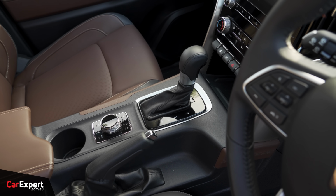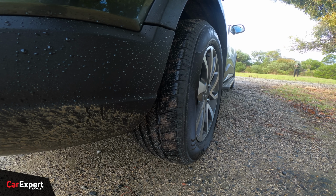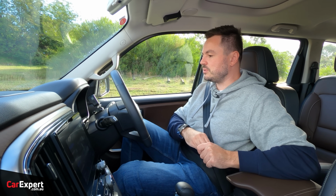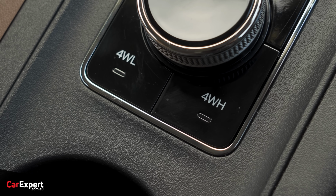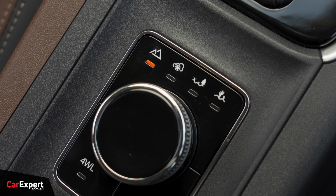In terms of the actual off-road equipment, you have basically a system that is two-wheel drive for sealed surfaces, so that's driving on a regular road, and four-wheel drive for unsealed surfaces, so things like gravel, snow, mud, that kind of thing. Now, the reason you can't use this in four-wheel drive on a sealed surface is because you could do damage to the transmission and the driveline, and to get a better idea of why that's the case, have a look at the video that's up there or in the link in the description below where I explain four-wheel drive modes.